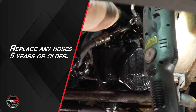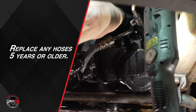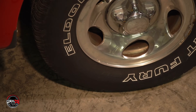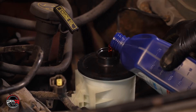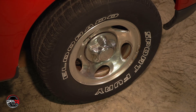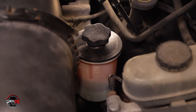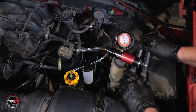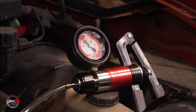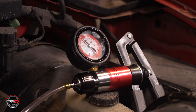You can now reconnect the two hoses with new seals. Now, before starting the engine, turn the wheel lock to lock 10 times. Refill the reservoir if needed. Then, start the engine and turn the wheels again lock to lock 10 times, checking the reservoir one last time and checking the system for leaks. Now vacuum bleed the system, and if everything looks good, the job is done. For more information on vacuum bleeding, check out our other videos.